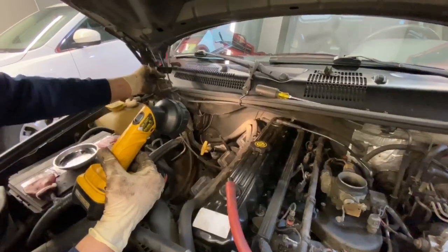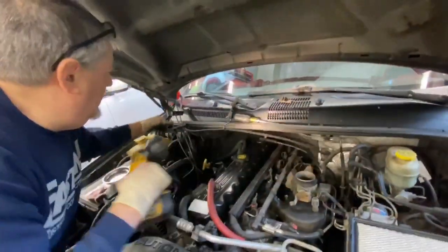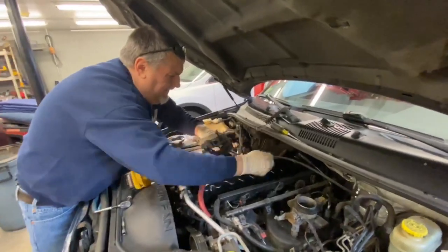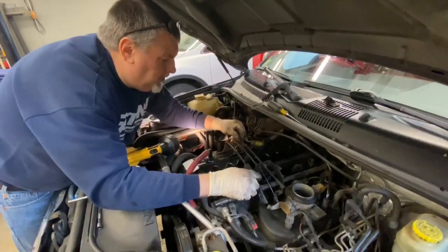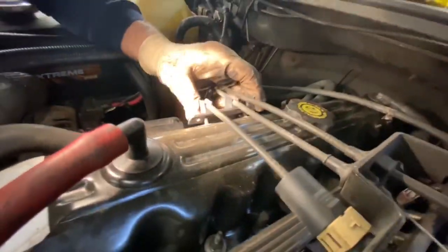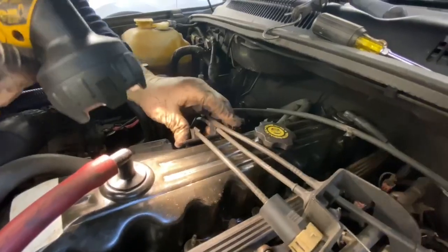We've got our cables here. We're going to take the bungee cord off, and we're going to set our cables back in place. These go back down to line up for the studs that we took off. And there's a clip right here on the valve cover that these two pop into right here. Now these things get pretty brittle, so you gotta be careful when you take these off that you don't go busting them, because they're gonna hold your cables in place, and they are important, so.